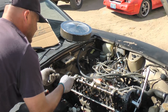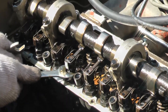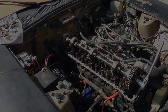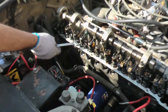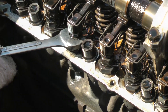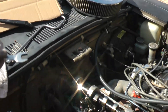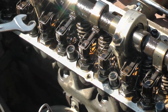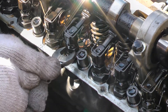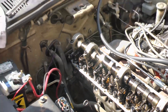Number five exhaust — break the jam nut, the holding nut. I need a more narrow 17mm; this 17 is too fat. For those ones, there's not a lot of clearance right here by these head bolts. There's not a lot of room, so I actually have a wrench that I shaved down just for this purpose — shaved some material off so I have more room on those holding nuts close to the head bolts. I just needed a little bit more room to break that loose, and that gave me just enough room. So now the jam nut's loose.